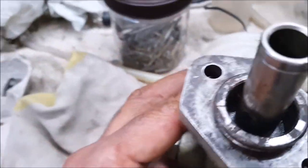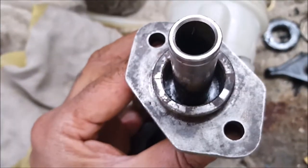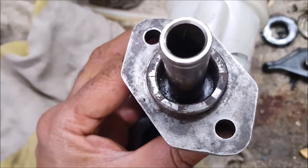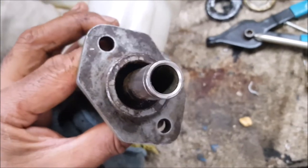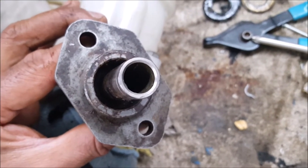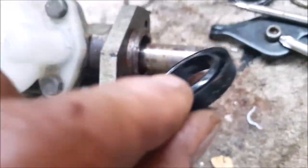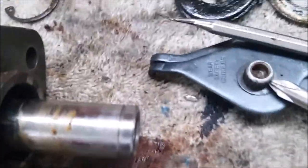I put in a third screw and levered off the head of the screw — it broke but I was able to get it out. Then there should be another flat washer in there to come out, and behind that is another circlip which we need to get to. That's quite deep down in the bore of the master cylinder. I thought it was a washer but it's actually just a seal, which I used a dental tool to extract.